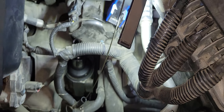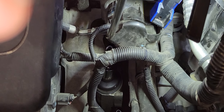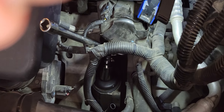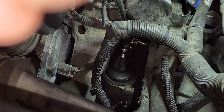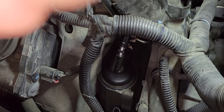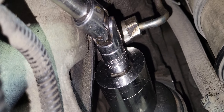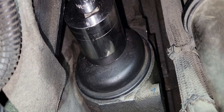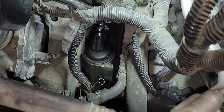It's also good to remove the dipstick so you have a little extra room. Then just take your extension, pop it into the swivel, grab your ratchet, make sure it's on there, and then give it a twist. Now the problem with this scenario is that once you start to back the socket off far enough, you actually hit that exhaust manifold. So you can only back it out so far before your socket gets stuck — it might be enough to loosen it up just to get it off with your hand, but sometimes they're on there pretty good.